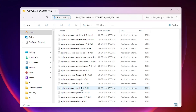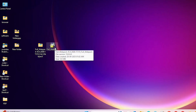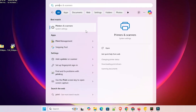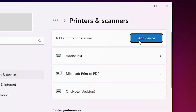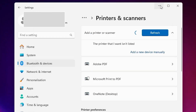After extraction is completed, here we find the newly created folder. We are going to install these drivers using the simplest method. The best way is to install manually. Go to Start, type 'Printers and Scanners', and click on it. Here we find 'Add a Printer or Scanner', click on 'Add a Device', and wait a few seconds. A new option will pop up: 'The printer that I want isn't listed' — click on 'Add a New Device Manually'.